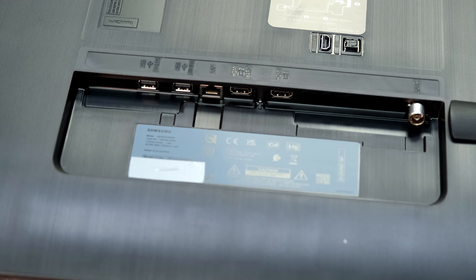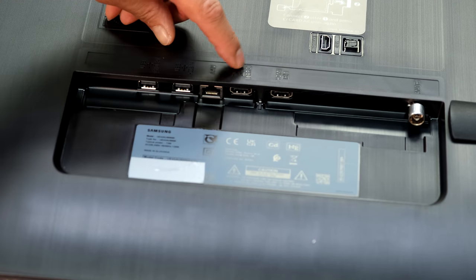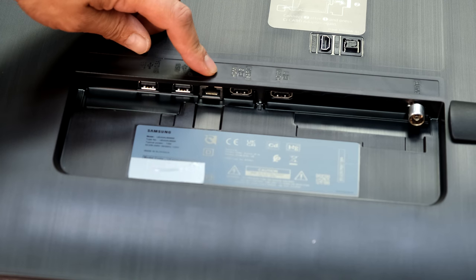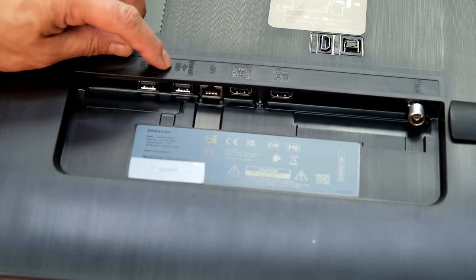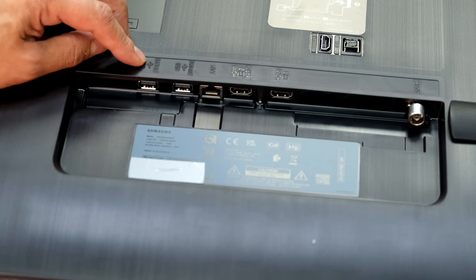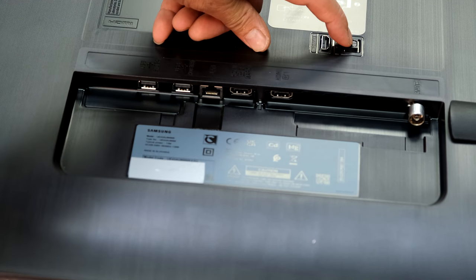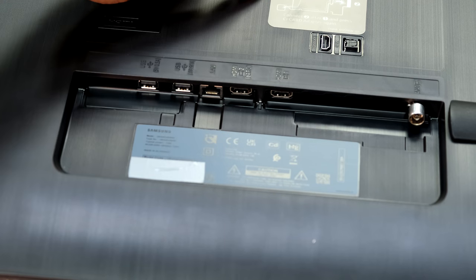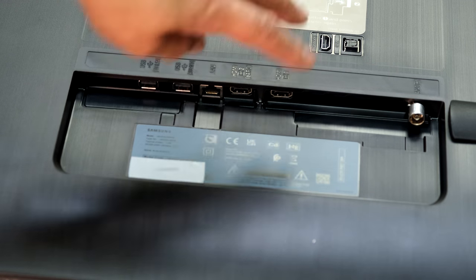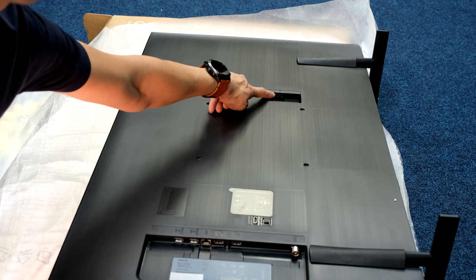Quick close up of the connections on the side. So you've got the aerial input there, then HDMI 1, HDMI 2 is eARC, Enhanced Audio Return Channel, wired internet in there or LAN, USB rated at 5 volt 1 amp for hard drive etc, and a half amp USB there as well. HDMI 3 is on the back, and also we've got digital optical audio out. Peel this sticker off here that's just in shot and put your CI card slot reader there. Further along the back there, we can just see where our figure eight mains input is as well.